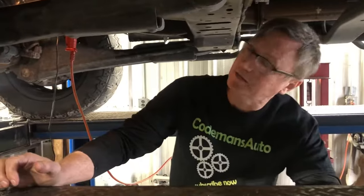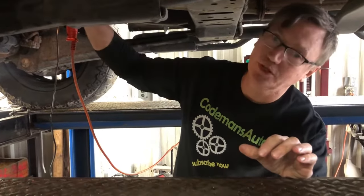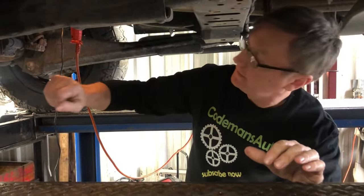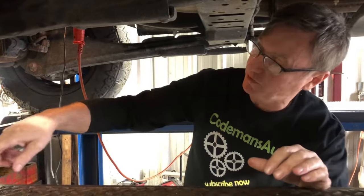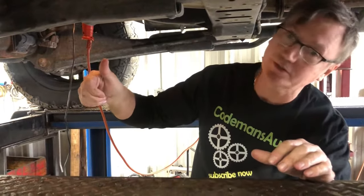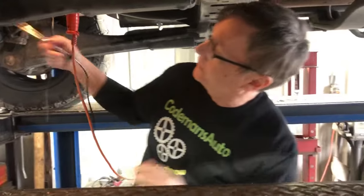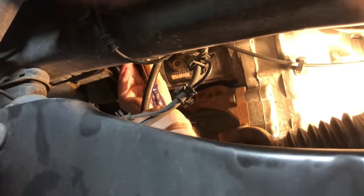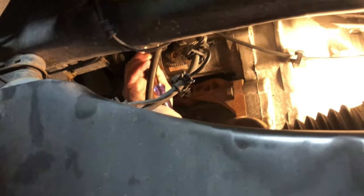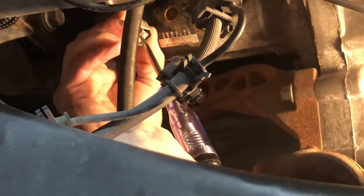This is how we diagnose this truck. We've unhooked the signal wire coming down from the ignition, and I'm going to put a 12-volt tester in there. Cody's inside the truck — he's going to try to start it — and I'm going to show you what should happen when he tries to start it. So we'll hook into the signal wire coming down. Okay Cody, try to start it.